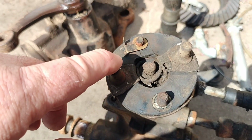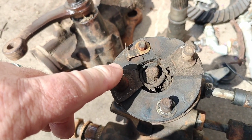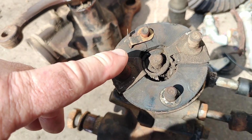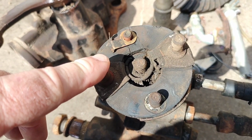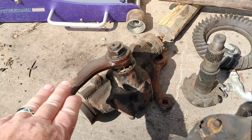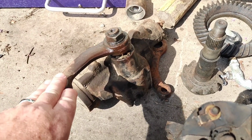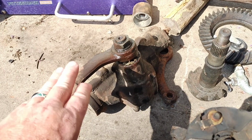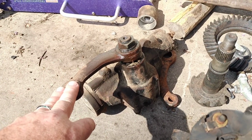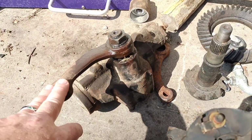And this one, the Bonneville one, like I said, I counted the rotations, and it's like 2 3/4 or 2.8 or something. It's less than 3 turns lock to lock. If you were to look at the standard 60s power steering, it's like 3.5 or 4 or something like that. But this one I think is 2.5. It's a quicker box, but when we traded the Formula Firebird 78 for the 69 to my buddy Ronnie, the 78 had the standard gearbox, and I think this is the quicker box, and it had a leak anyway that needs fixed. I don't think he's fixed it yet, so we'll probably just let him take this box back and have a quicker ratio and a box that doesn't leak, and that'll be nice.